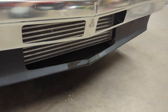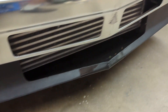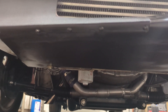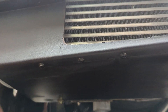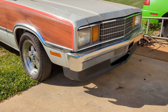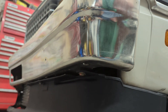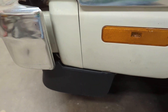Now that I ruined this perfectly good chin spoiler, it was just a matter of filling in the gap that I had made. I trimmed the chin spoiler to allow more airflow through the intercooler, and I fabricated this aluminum piece here, which I painted black. This doubles as a mount for the bottom and also acts as a little tray to help direct air into the intercooler. I set it up to screw into the spoiler and into my intercooler mount. The top mounts with a couple of bolts right to the existing bumper, and the side mounts to the fender with just one bolt. It's definitely not perfect, but from a distance it looks pretty good, and that's good enough for me.